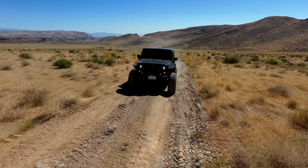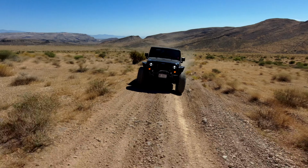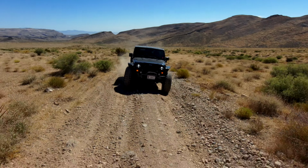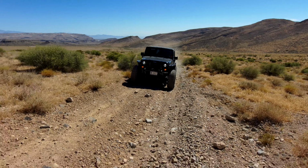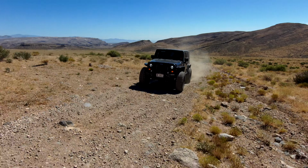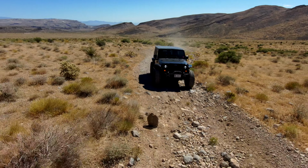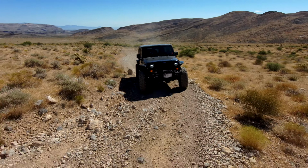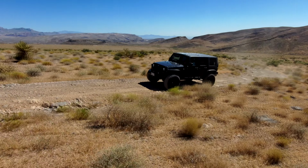And Chrysler's done a pretty good job updating the Hemi, but it's still cast iron, it's lower compression, and the transmission isn't as advanced. If you got into an LT with a 10-speed versus a Hemi with an 8-speed, you would notice the difference right away. You would notice the power delivery on the LT is a lot different. The power delivery is pretty much linear from off idle to about 4,000 or 5,000 RPM with the LT. And when you combine it with a 10-speed, there's power there all the time.